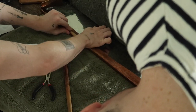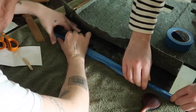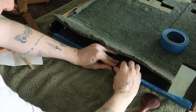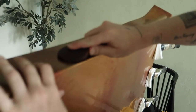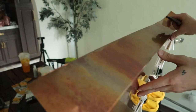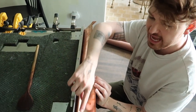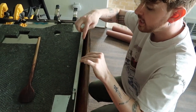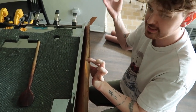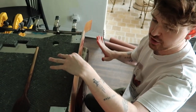I folded over that copper edge and cut away any excess. I actually used the screws that fasten this to the front of the dishwasher door to screw down the copper and hold it in place while it was gluing on the edge. I used some pliers to fold over the smaller edge at the top, and scissors to fold over that small edge at the end. At the very bottom we have about a half-inch section, so I added epoxy and left about an inch of copper to fold up. If you don't have clamps, painter's tape also works great for this process.